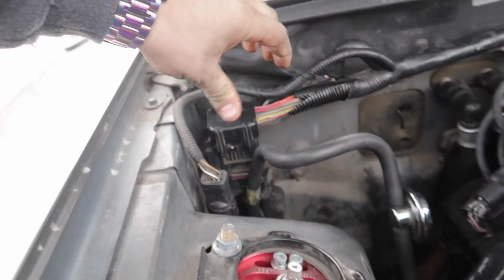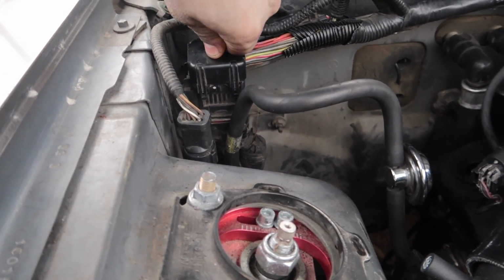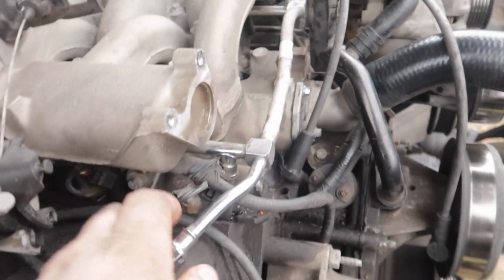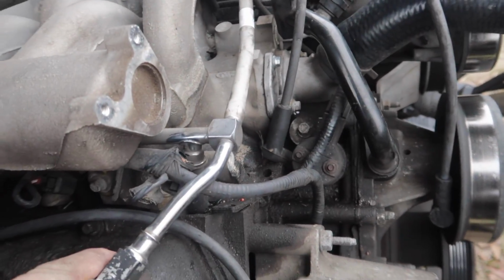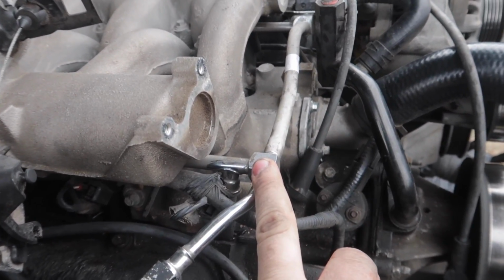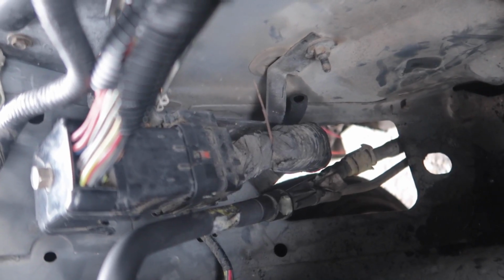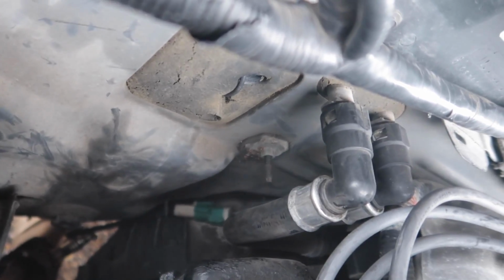The basic necessities. This is the harness for the engine, pretty much. This is the engine control harness. Your fuel rails and all that fancy stuff are gonna be on here. That's that harness. This is your fuel line, which I wanna make bigger. I'm probably gonna end up building some bigger rails eventually. This is all aluminum, I'm pretty sure, so I can just weld on and make my own aluminum rail and then attach some 6AN bungs so that way we can get some better fuel inside of these guys. Also, possibly another custom intake soon. I got some ideas in the works, but I'm also gonna have to run PCV, and delete EVAP, EGR, and all that stuff. Also take out those O2 sensors, which means I need to take out the full exhaust.